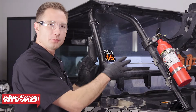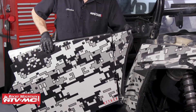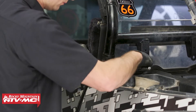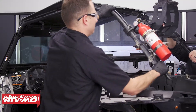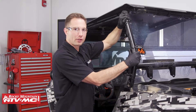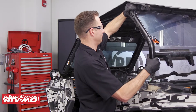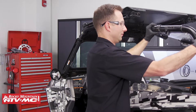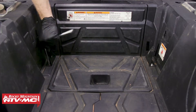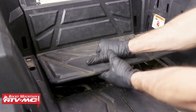The next thing we're going to do is remove the rear portion of the roll cage. To do that, we'll remove the doors and the stock seat belts, then remove the hardware from the rear portion of the roll cage — it's a good idea to have a friend help you lift this rear section off. For the last section, remove the top bolts from the roof so you can lift it up. Now that the rear roll cage is removed, check the cargo bed for any brackets holding accessories and any wires, and get those removed.